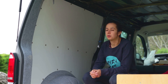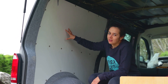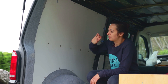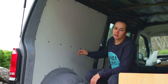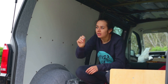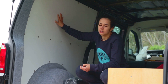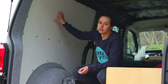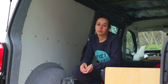Today we've got the unpleasant job of taking these wall panels off and putting them back on again, which was not very fun last time. The reason we're doing it is because these plastic clips holding the panels in are completely rubbish — some of them have popped out, and we really don't think they'll hold when we try to attach furniture to the wall. We worry the wall will just come off. So instead we're putting jack nuts in with metal bolts, which should hold it on much better.